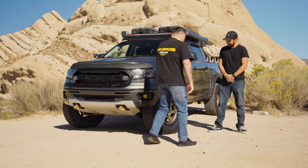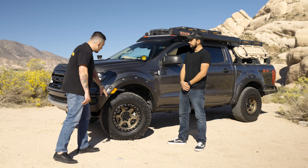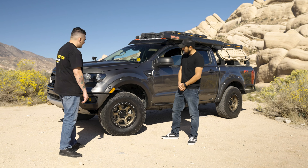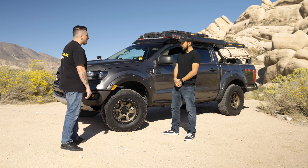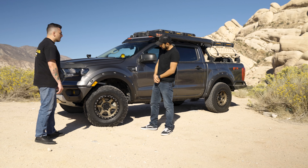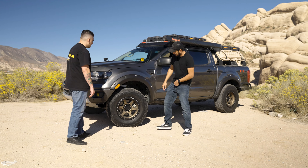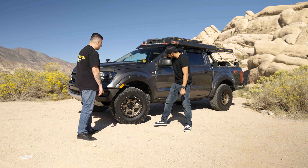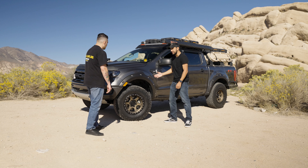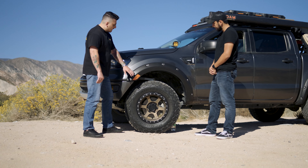When most people run a lift with bigger tires, they have issues with the fenders. Did you have to do any cutting? For 33s you don't have to do too much, but on Rangers we have front and rear intrusion beams that get in the way, so I ended up cutting those out completely and welded a bracket to the cab mount for support. We also cut the front bumper a little bit for clearance. I have these Rough Country pocket fender flares added recently, and underneath I did have to do a lot of fender cutting as well.